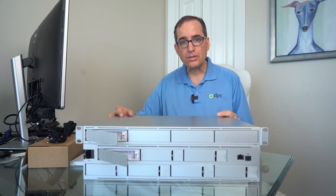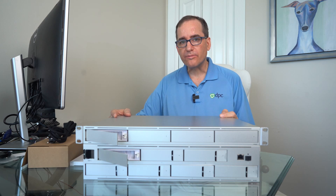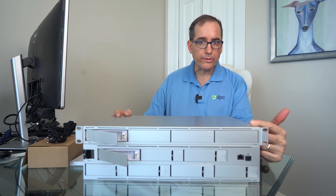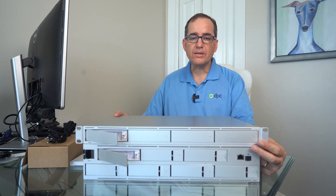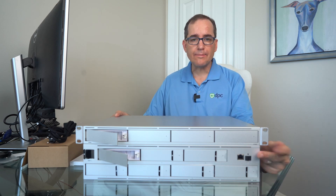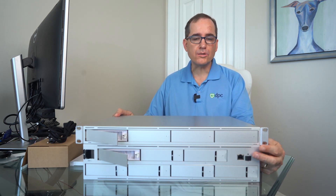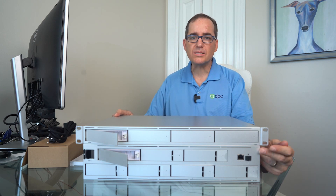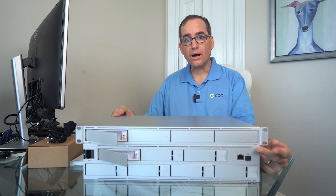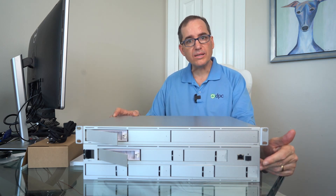I'm actually going to fill ours with seven 4TB drives — it seems to be the right price and performance. I have it more as a test unit and for a practical application in our office. Obviously this one is a 1U unit and the UNVR Pro is a 2U unit. One of the bigger differences is that there is actually a display on the new UNVR Pro. I just did the Dream Machine Pro review — first time I had a Ubiquiti device with a screen. You can see basic info like IP address and status. Also, the UNVR is a 120-watt power supply and the UNVR Pro is a 200-watt power supply, to power seven hard drives as opposed to four.